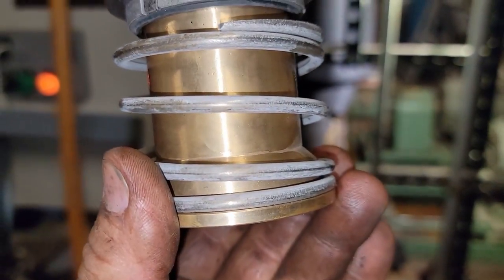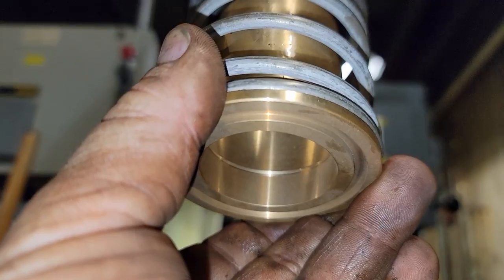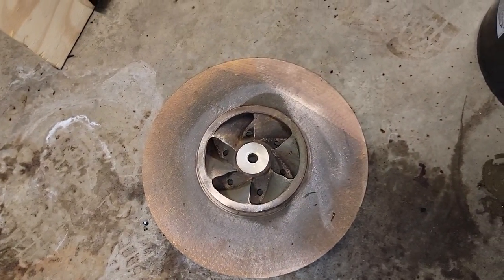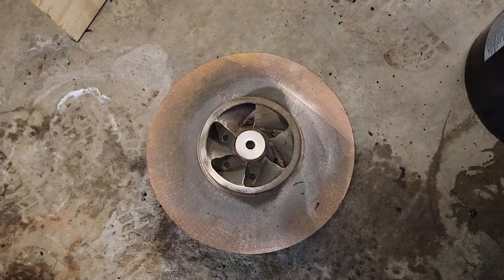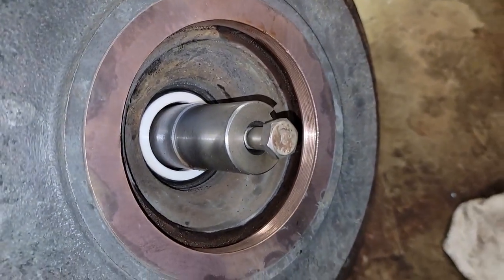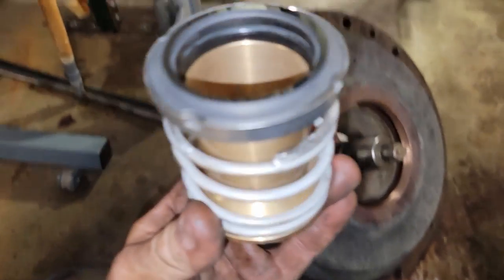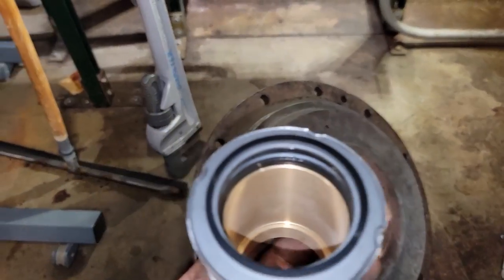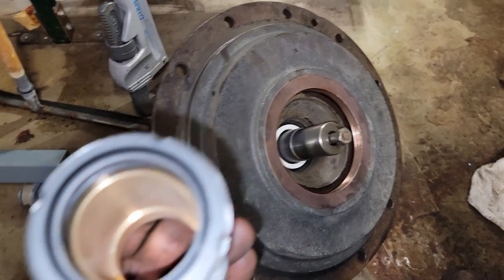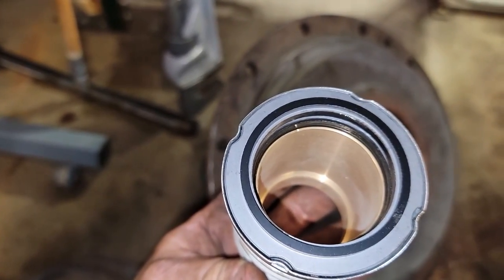You've got this piece here which is your black ceramic encased in rubber; the rubber touches the brass, it's going to slide down onto this brass; the spring's going to put pressure against it. On the back side you've got an o-ring that goes between the brass and that cut mark there — that's going to go on the back side of the propeller. Then the bolt is going to go through the center of that propeller, which has rubber between the head of the bolt going down into the spindle, and that basically seals it. Everything on the inside of this brass is completely dry; the outside's got the water on it — that's how it seals the spinning part.